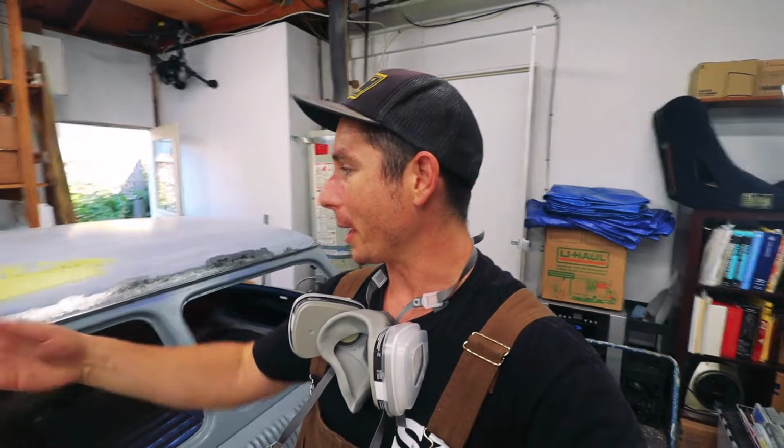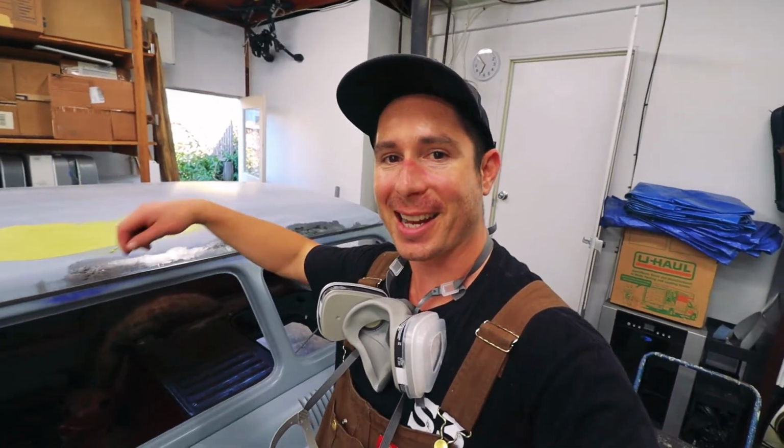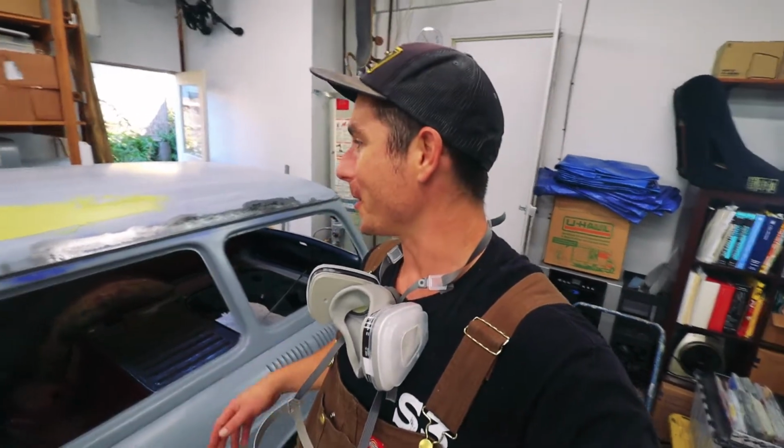I was all stoked. It was nice and smooth. It felt like it was gonna spread pretty well, and then by the time I started laying it on the car, it just went off, just immediately. So, kind of a big fail, but I mean, these things happen. I'm learning this product. I'm gonna have to sand this out and then we'll come back and do it again and we'll add less activator and hopefully get it right.